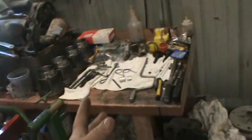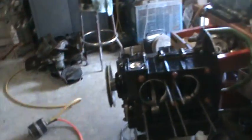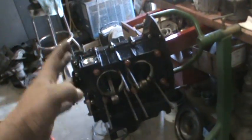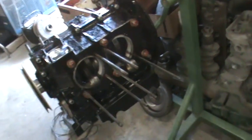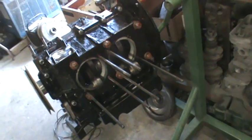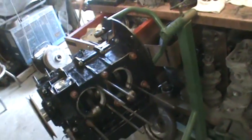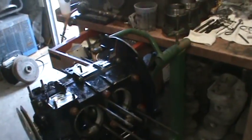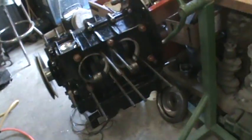I had to take this one back apart and just replaced a few of the bearings that were grabbing. I'm still waiting on parts for this motor and I think it's going to come apart a third time — although it spins nice, it's not spinning as nice as I like. The freer it is, the less friction you've got at startup and the longer the motor life will be. These 30-minute engine assembly videos are a thing of the past because the quality of parts just aren't allowing a one-time assembly anymore. I'm going to have to start assembling the motor without sealer once, torque everything, make sure everything rotates, then take it apart and put the sealer on.